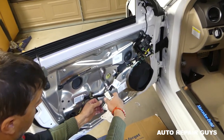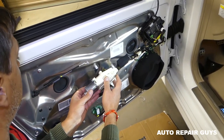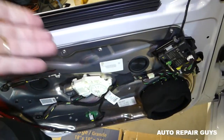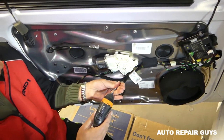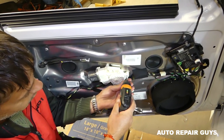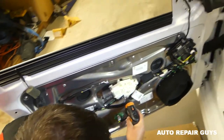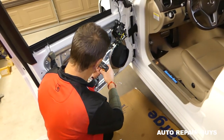This is the window motor from our 2014 Mercedes C250. For the new one, push the wiring in, get it into the glides, and you may need to twist a little until it goes directly in. Install the three screws. Put the door panel back in reverse order. We'll use a power screwdriver to save time. That's the whole procedure — if you need anything let us know, please subscribe and see you next time.